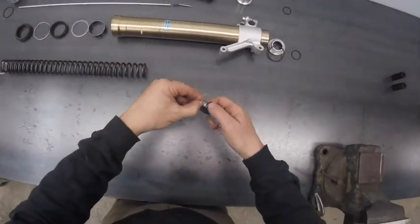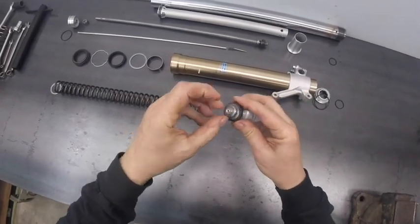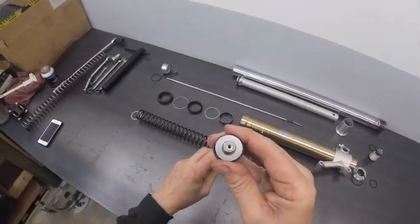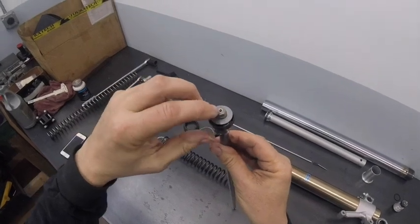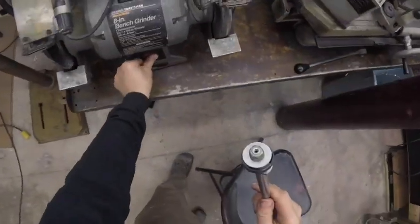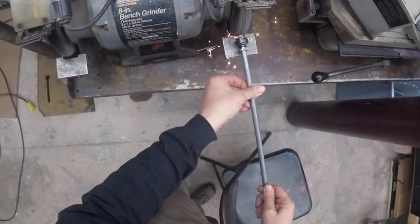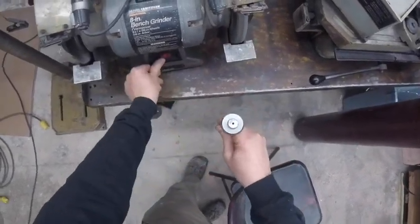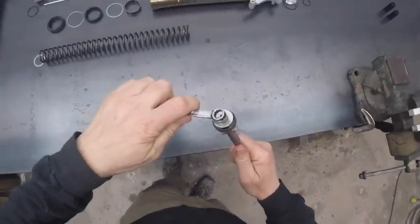I'm just going to tell you how we take them apart. The metal of the thread has been flared when these forks are manufactured. You can see the punch mark on the end of this. So in order to get these nuts off without damaging anything, we have to grind the end flush. That's about all we need to do — just grind that rod flush with the nut to take the swaged section off it.